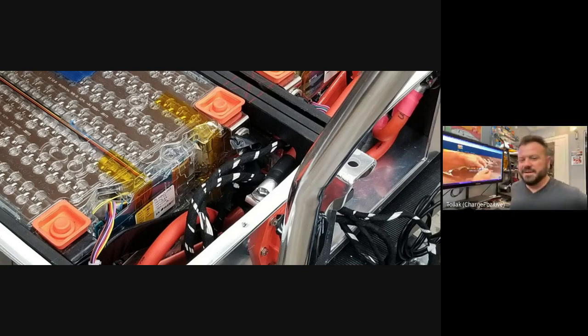Well, I would actually love to talk about this in depth. It would be great to do a whole battery talk about my situation. But anyway, my original pack was replaced at 40,000 miles. It had a BMS A066, and then my first replacement remanufactured pack after 20,000 miles of driving had the same exact BMS A066 problem. And now I'm on my third pack at 60,000 miles. So far, hopefully it's still okay now that I'm out of warranty. But I've been talking with Johnny and other people about how to make sure it doesn't happen again, at least with whatever's in my control beyond faulty cells, like you said.